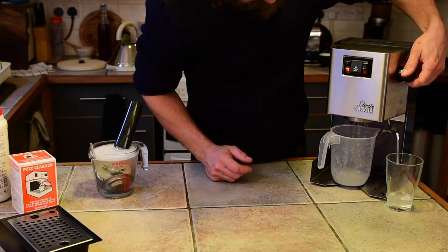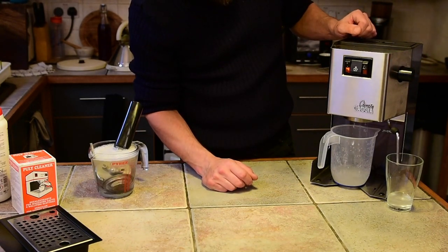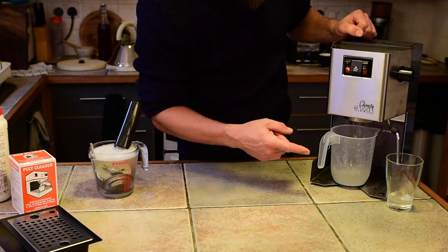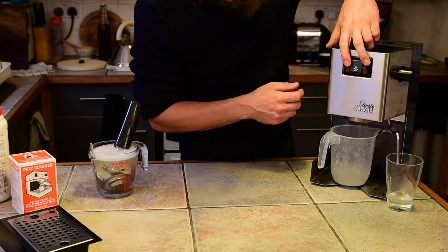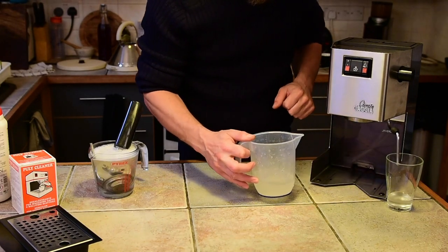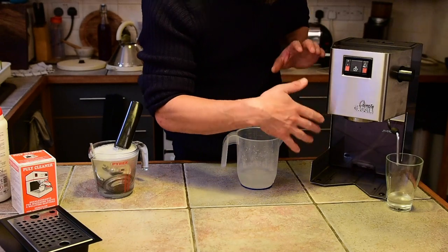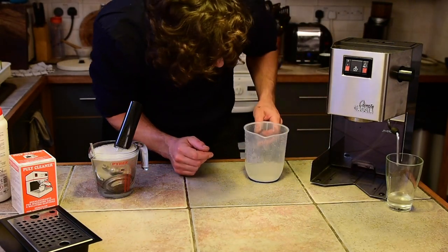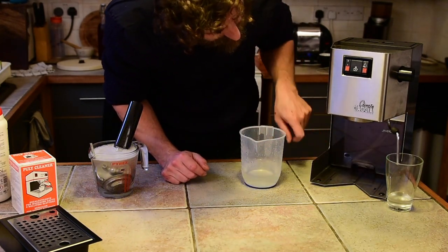Okay. Now, let it go a bit more. Just so you know, the water in the boiler has been refreshed with new descaler. Okay? And off again. Alright? And again, I'm going to wait another, say, 5-10 minutes or so, wait for the descaler to do its thing. Okay? And basically continue this process until all, or nearly all, the water has been used up from your reservoir.